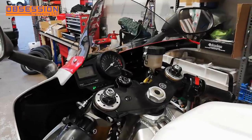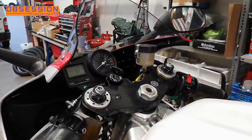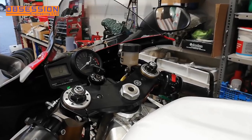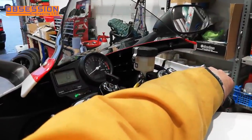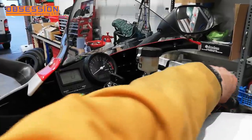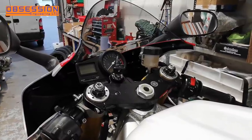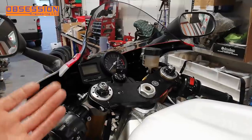Like a dog with a bone I just couldn't quite give up. I thought I'd take the baffle out of the exhaust pipe and see if that makes any difference — which it didn't. And then I thought I'd better just check the manual. The air screws in the bottom of the carburettors — what they call the pilot screws, which are an absolute pain to get to — were set at three turns out and they should have been at two and a half. So I gave them a little bit of an adjustment. And it's not perfect, but it is considerably better. So I think maybe another little tweak of the pilot screws another day and we might have that about cracked.